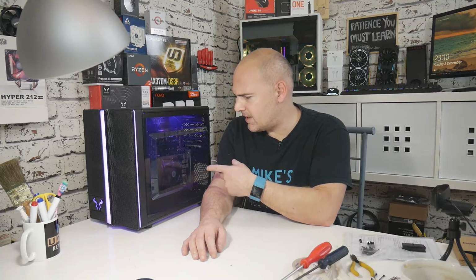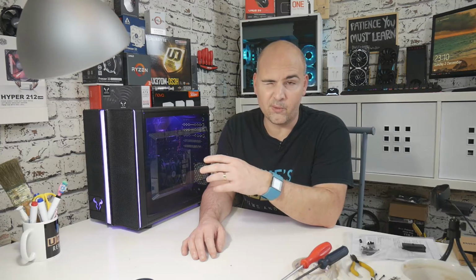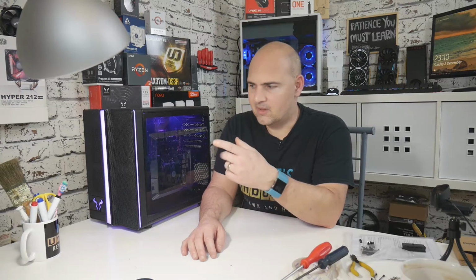I'll answer both of those questions regardless. The GPU in there is the Vega 3. In the Ryzen 2400G, you've got a Vega 11. In the 2200G, you've got a Vega 8. And in here is a Vega 3. So if you are aware of the approximate performance of the 2400G and the 2200G, this is about half the power. So again, it isn't great.